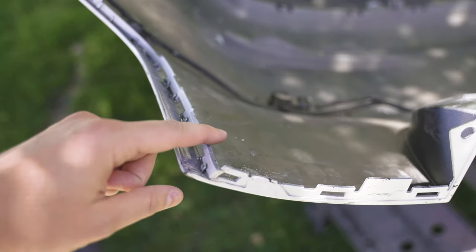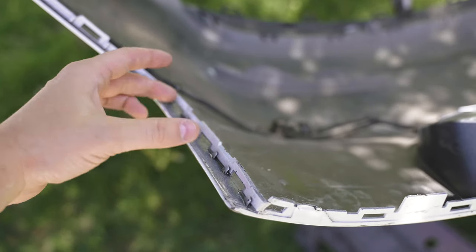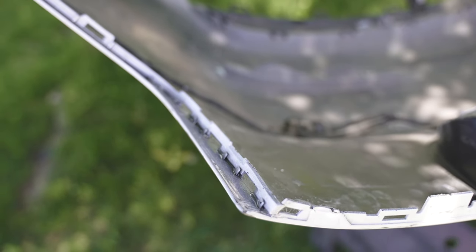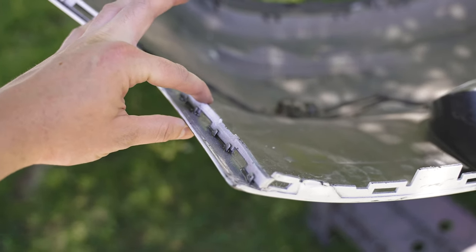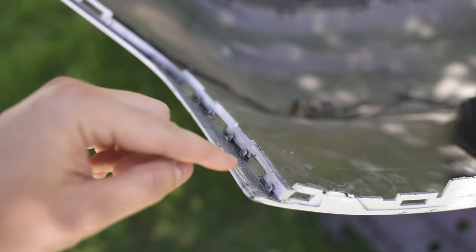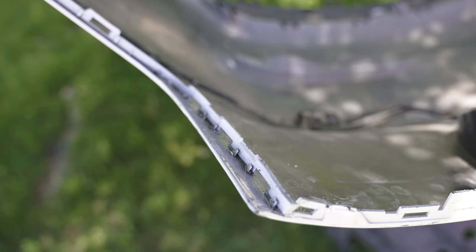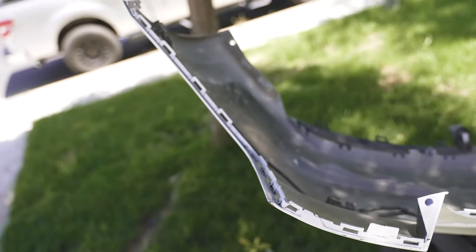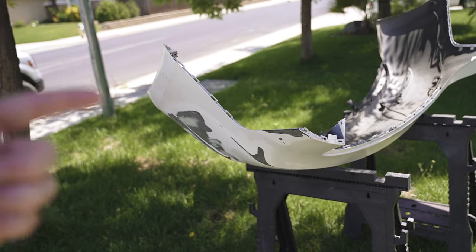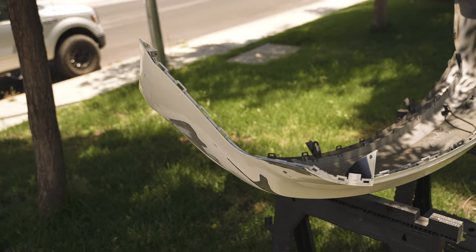The only damage on it was this section from here up was disconnected. It kind of just popped off. The little plastic weld just popped off. So I just pushed it back down, and then I used a little bit of hot glue just to hold it in place on the back side. Front side I did epoxy, like plastic epoxy that should hold just as strong as before. Crazy how minimal damage there was really on this car. It was really just the dent pull and bodywork on that section, and then just repainting the bumper basically. So anyway, that's what I did. Let's get back to painting.